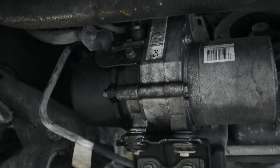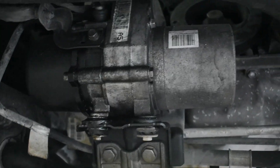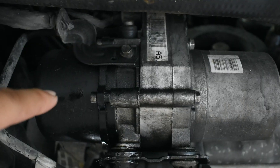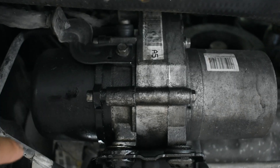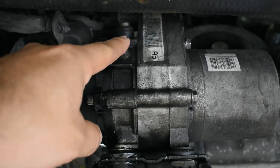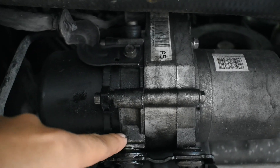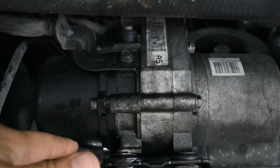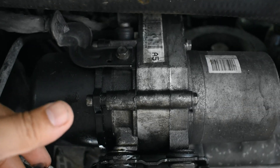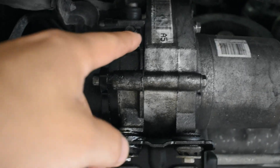Here's the pump. If you're trying to buy a new one, the whole thing is going to be a little bit expensive. So what we're going to do is try to repair this power steering pump. I bought a kit. There is a seal — an O-ring — that goes in this area right here. With time, like every other seal, it gets old and it cracks. It doesn't hold the pressure of the power steering fluid, so it's leaking oil.